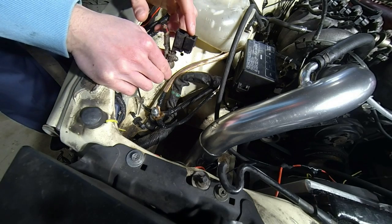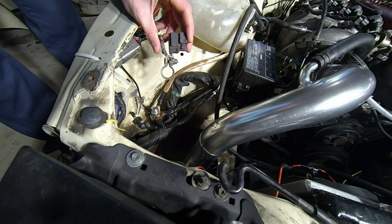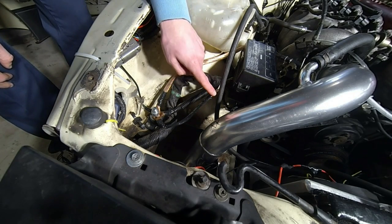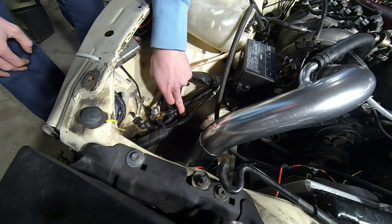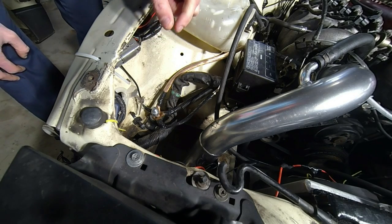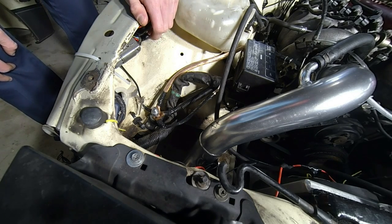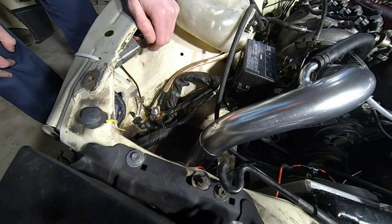This positive cable holds your power wire — it powers everything and also holds your starter and alternator wire. I went ahead and chopped these off so I could put a fresh eyelet on them to secure to my common power stud. As you can see, I have three or four different lines going to it: the power wire to my fans, the starter and alternator, the battery relocation wire, and the power wire going into your fuse box. I did secure this down, bolted it down — it's sturdy, it's not going anywhere. I used very short screws to minimize the possibility of anything sharp underneath causing problems.